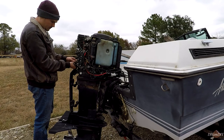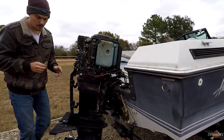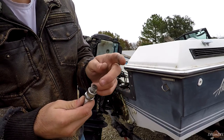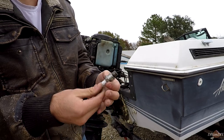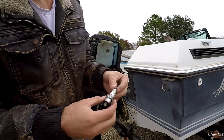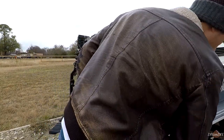This spark plug's coming right out, so let's hope no water was getting in there — that's going to really suck. These are a bit of an odd spark plug. Maybe the piston cylinder comes down and gets close, or it jumps a gap across these two electrodes, or it jumps a gap with the cylinder head. Not too sure, but either way these are maybe an older way of doing it. The part number is BU-HW2. I went to AutoZone and they only had two of them in stock. So let's go ahead and take one of those out and get on a compression tester.